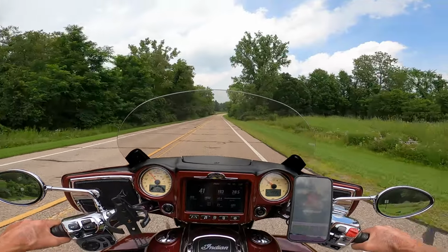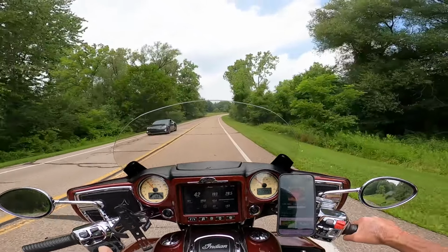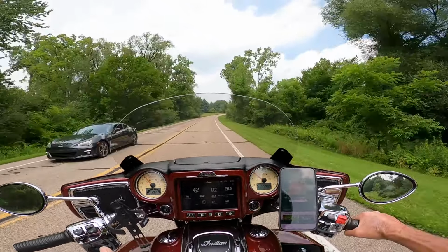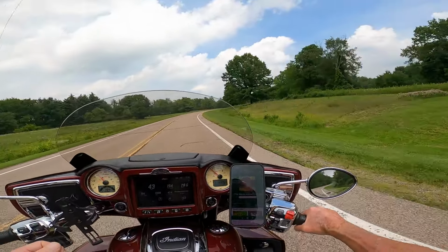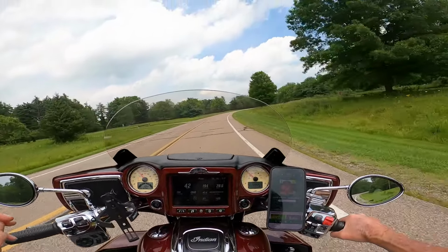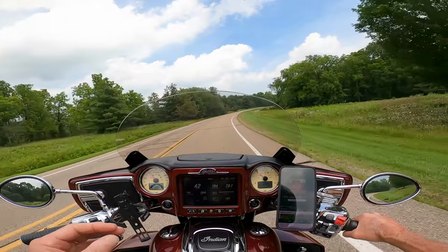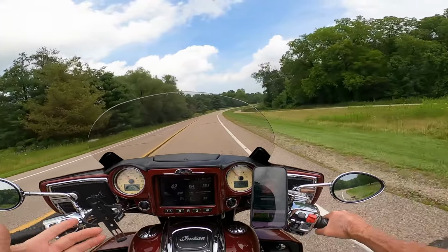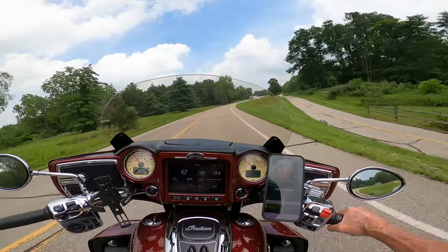So at 45,000 miles, as part of my service, I had them clean the sensor, and that's all they do. They don't replace it, it just needs to be cleaned. There's oil that flushes by it, and it gets a little buildup after some time. The new design on the Thunderstroke, I believe, moved that sensor so that it doesn't get direct oil and doesn't have that deposit issue. So that was the only other thing. Let's see, what else?